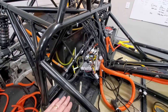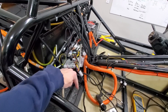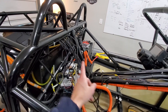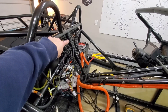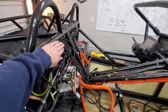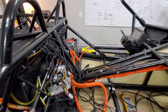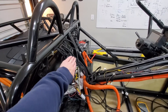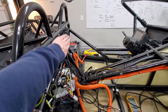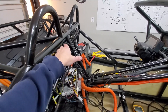Just so you can see the layout — this whole back area here, the seats go in front of that frame member. I'm going to make a fiberglass shell that, instead of following the crossbar, goes more straight down behind each seat, giving a little cubby behind each seat for storage. I'll have to re-fiberglass that area and use it as the new boundary. Batteries and everything will be on this side, and this whole area will be the high-voltage zone.